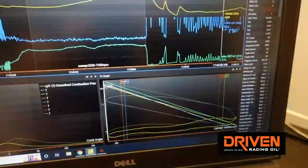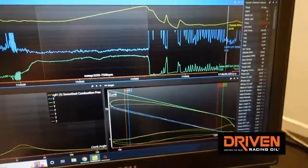So now we can actually look at cylinder pressure graph data against crank angle and learn all kinds of things about the engine. What we found immediately was the tune-up was really compromised on some cylinders over the others. Now we could go in and use this cylinder pressure data and track, for example, one point which is what we call CA50.